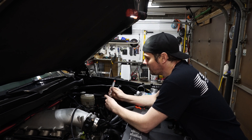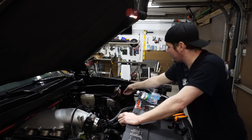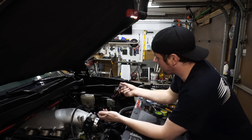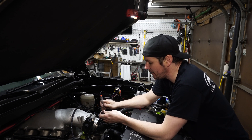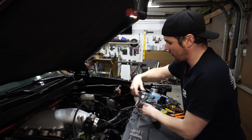There's our hot, there's our hot — all eight hots are good to go. Now the next step is to test the triggers. As you can see, we're on the hot lead right now. If we plug into ground, we've got nothing because we're not making a signal through ground — we're going to have to use the MicroSquirt to do that.